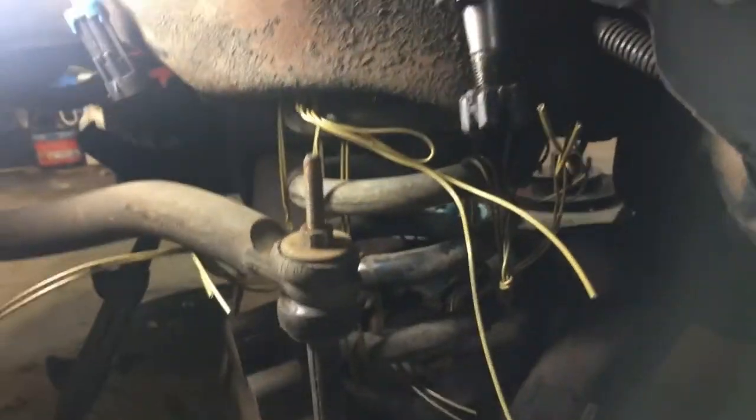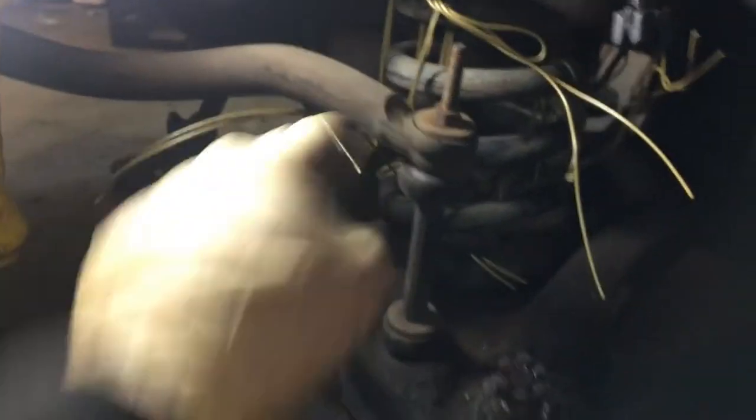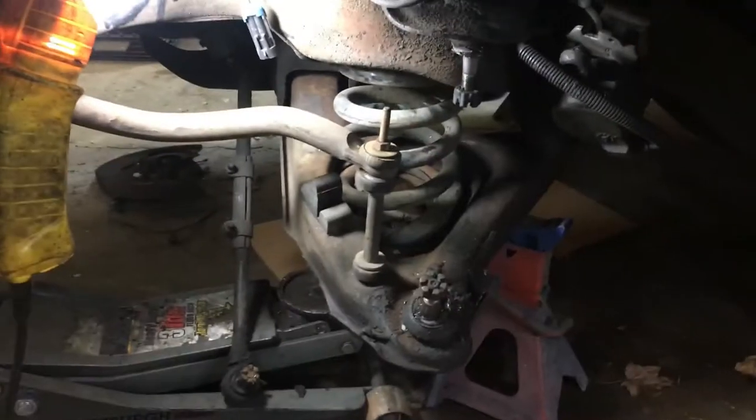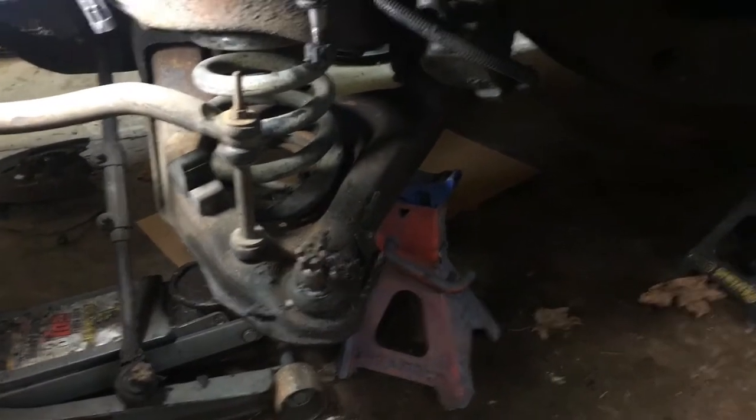I compressed the spring as far as I could with the spring compressors but it was blowing zip ties apart, so I took a bunch of bailing wire and tied it tight around there. That got the spring short enough to slip in, put a jack under the control arm and push it up. Now I have a nut on the sway bar to keep it from popping out. I got the sway bar tight, all the bailing wire cut off the spring, and a jack stand underneath the control arm. Off to do the other side — bailing wire is always useful.